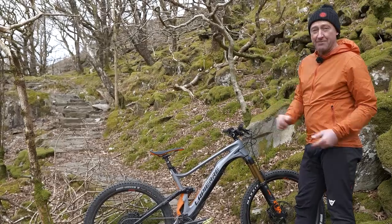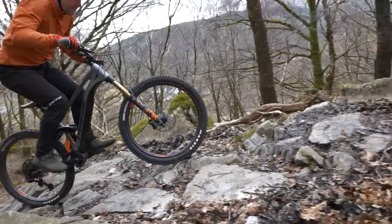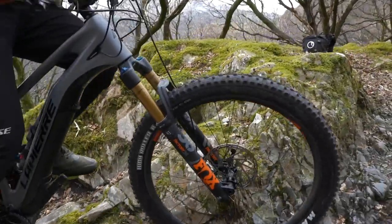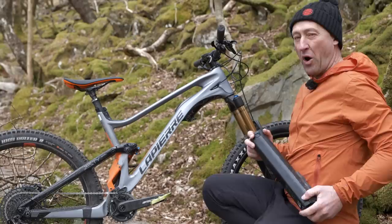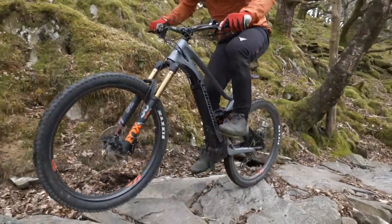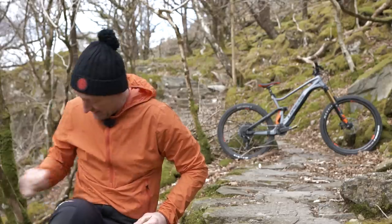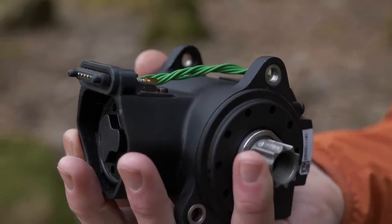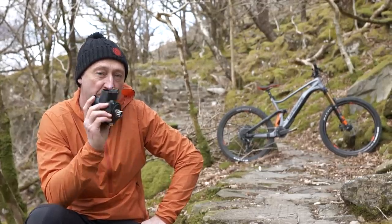I've just done a run on the updated Black Pepper version of the bike, and I really think it's on terrain like that steep, steppy going where the increased grunt really does allow you to conquer those difficult sections. Remember that this bike is also a mountain bike - by removing the drive unit and battery you're taking 3.3 kilos out of the bike, but also removing its capabilities. What you're left with on the bike is a bottom bracket unit weighing about a kilo - located low and centrally on the bike, which means improved stability and grip.